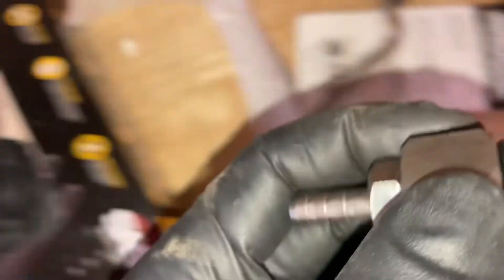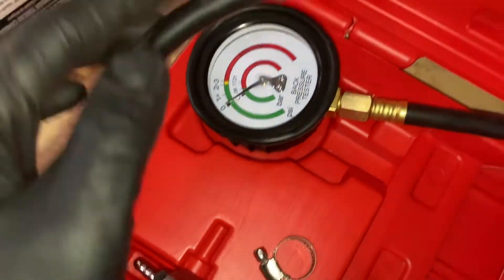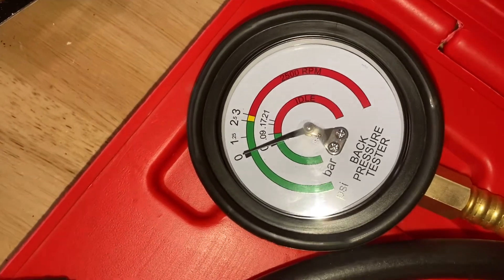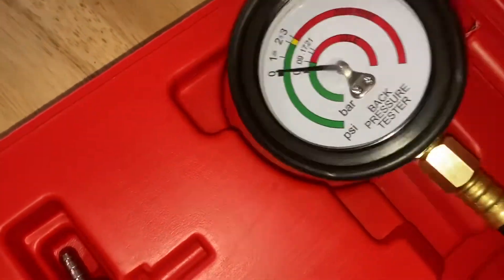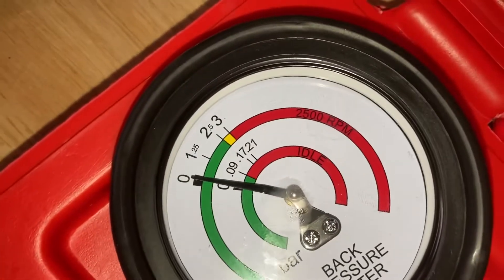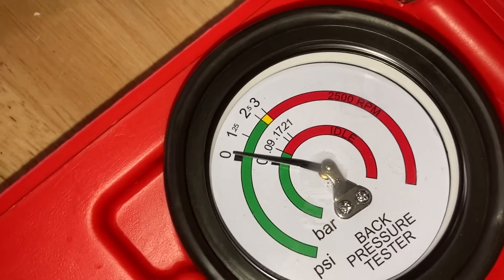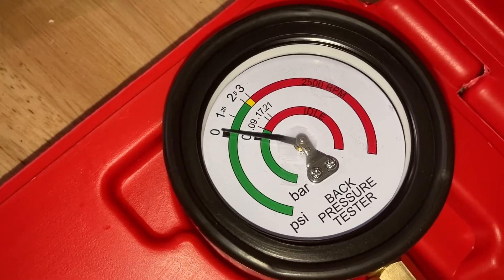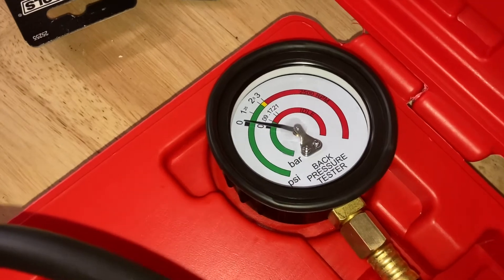As you can see, that's the same thread as the O2 sensor from the Ford, so we're in good shape. Once you've got it plugged in, you start the engine, run it at idle, and it gives you your back pressure reading. We have both the idle measurement and then you kick it up to 2500 RPM and do the same test. If we're getting anything above 3 psi back pressure, then we have an issue with a clogged catalytic converter or potentially the muffler.